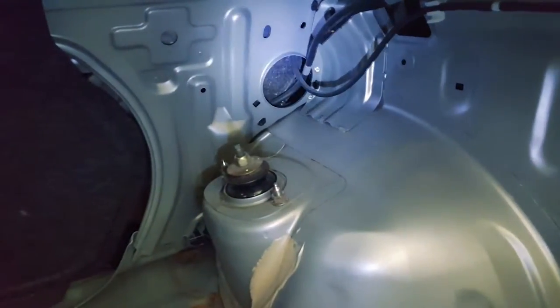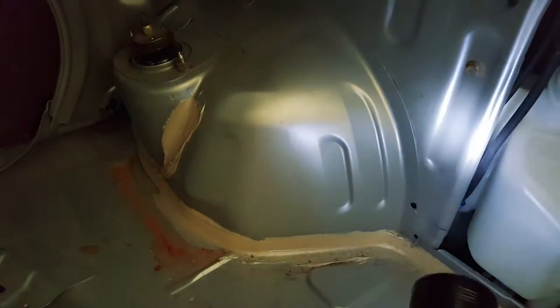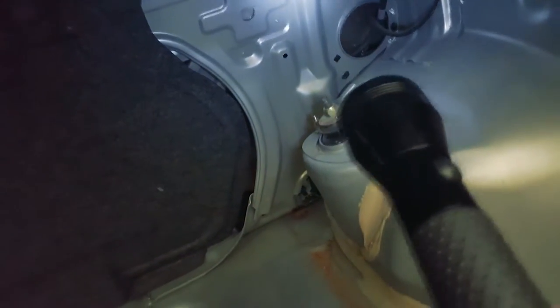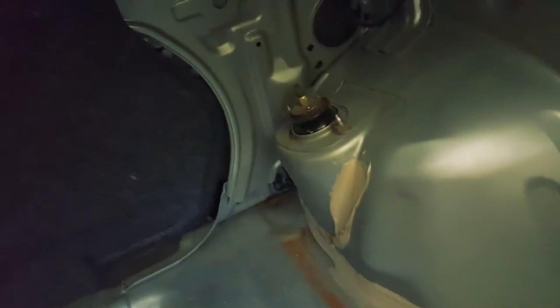Took out all the plastic — sorry, carpet lining. As you can see, that is the hole in which I will be running the cable into the cabin. I'm still thinking if I should put an inline fuse, probably a 120 or 150 amp, and either tying the positive here or putting it up here — there are a lot of places where I can actually put it. Yeah, so from here on out I'm just gonna clean up this area because it's really dirty.